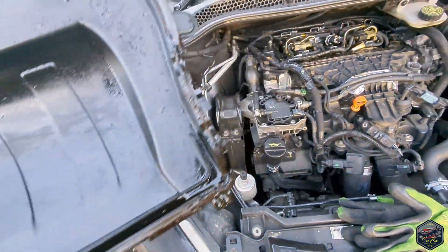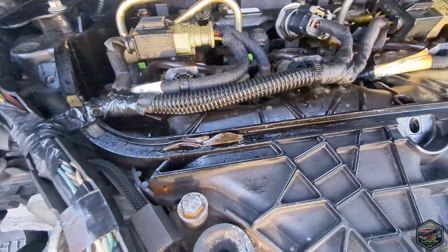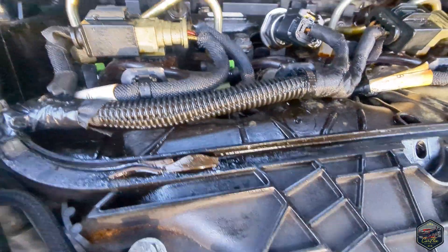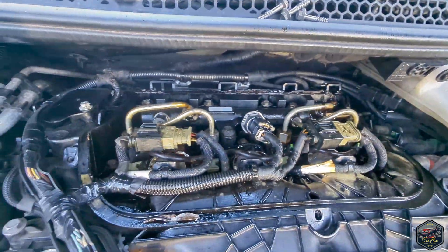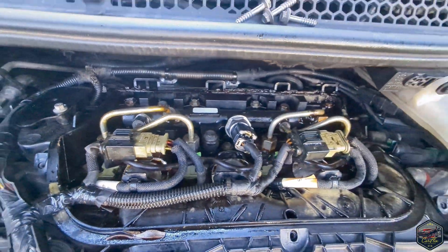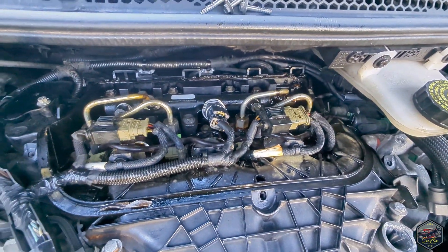As you can see, because it's been going on for such a long while — I can't believe I haven't seen this before when I'm servicing the car — it's actually perished all of the gaskets. I'm going to have to get a new gasket for this. It's completely mashed. But it has come up really well. Still really dirty down there, so I'm going to rev the car and try to see which injector is causing this issue.